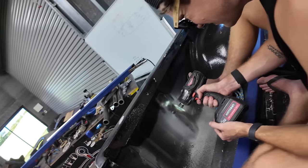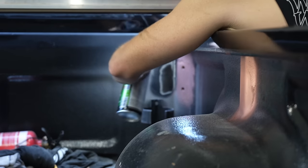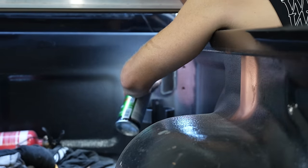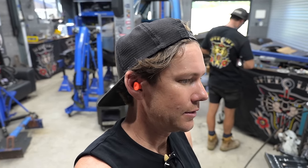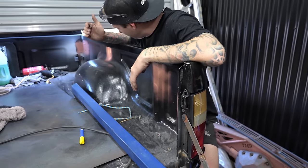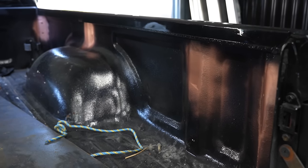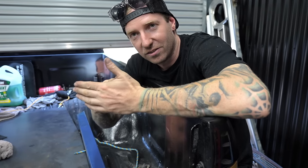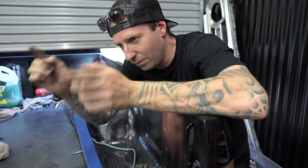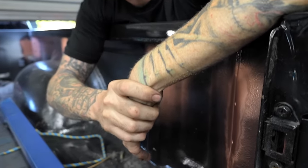It's a bit rough on the gear, this one — the 4.0, it's just annihilated. I've quickly whipped around and cleaned off the paint on the tub so we can weld to it. It's good because you can weld through it — it's copper rich so it's conductive. And two, when you sandwich two bits of metal together it seals the two surfaces between them, so you can weld around and everything inside there stays rust free.